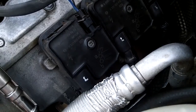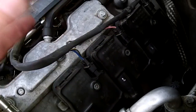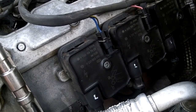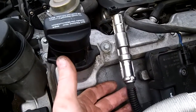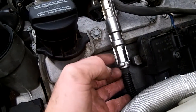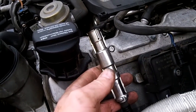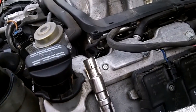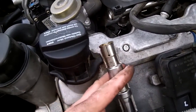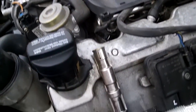Now we'll easily be able to pull all these plug wires off without having to disconnect them from the coils. It's easier to just unplug the plug wires and lift the whole coils and plug wires up and off once the plugs are unhooked. It's a long metal end on the plug wire — don't pull by the wire, pull only by the metal part. If you need grip, take a pair of needle nose pliers, stick them in and pry out — you can do that as well.